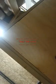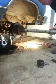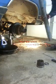That didn't require anything. Which probably tells me I have to change out some parts. That was far too loose. Like I said earlier, 60 foot-pounds is recommended. Well, it looks like you've fallen over. Well, darn it. Must have been too much power in my torque. So, anyway, you just unscrew this. It takes a little bit longer. And she comes out.